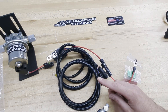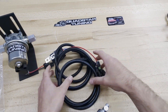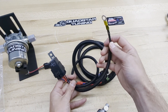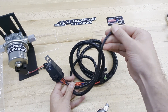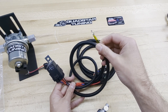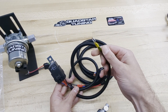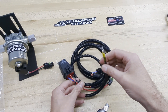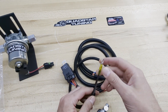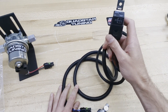Now that we have power to our relay, we need to complete the ground connection. The main heavy black ground wire needs to go to an intake manifold bolt or stud to give us a solid ground. The engine is already grounded directly via the battery cable, so anywhere you connect there will work. It just needs to support the amperage of the lift pump — don't connect it to the fender or anywhere without a solid ground.